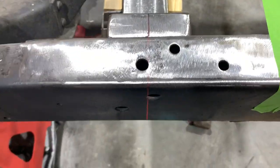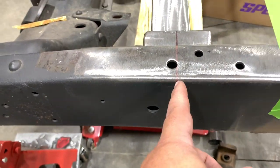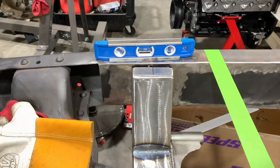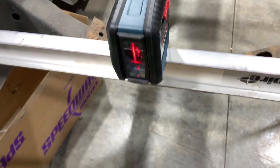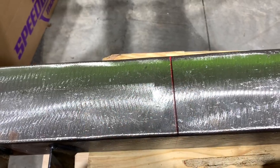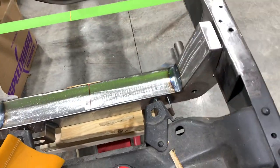Let me show you what I did. I've got the crossmember in place here. You're supposed to measure from the center of the spring perch — 20 and 7/8 inches to the frame — draw your line up, and remember we marked our crossmember earlier so that it would line up with our mark, which it does. We did the same thing on the other side. Our frame is level front and back, level side to side. I marked the center line on the crossmember and took this piece of tape, measured across the frame from both sides, found center there, and we're using a laser level so that we can make sure we are dead center on both marks. We had to come over just a tap — and now we are dead on centered up, dead on right here and right there, dead level this way and that way. That's exactly where it needs to be.